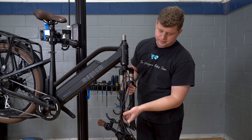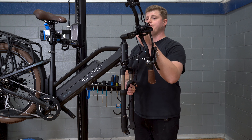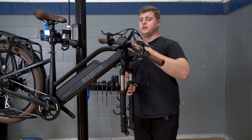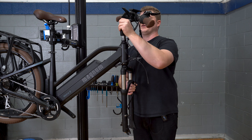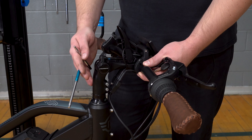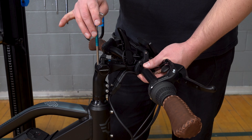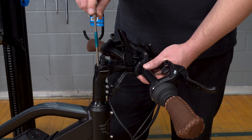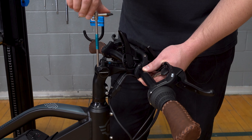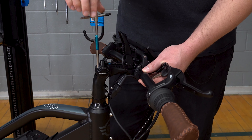From there we're going to take our wiring harness and go ahead and install that first. Take your time here, be gentle with the system, and then we're going to go ahead and install the stem on our steer tube. Now that we have our stem installed onto our steer tube, this is where that 5mm bolt comes in. If you drive your 5mm Allen wrench down through that hole that we discussed earlier, you'll feel it connect with a bolt and we're going to want to start tightening that.